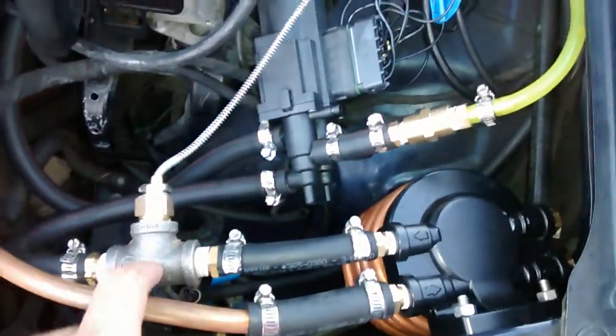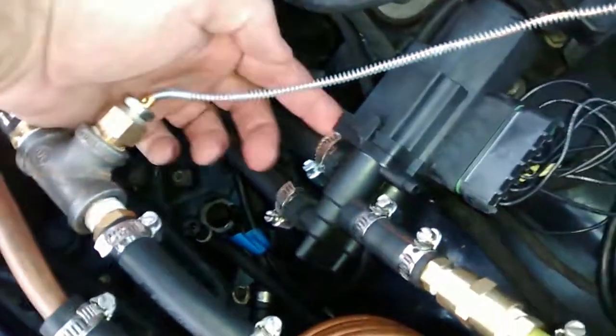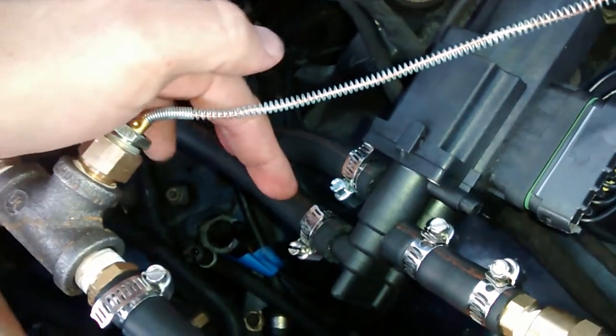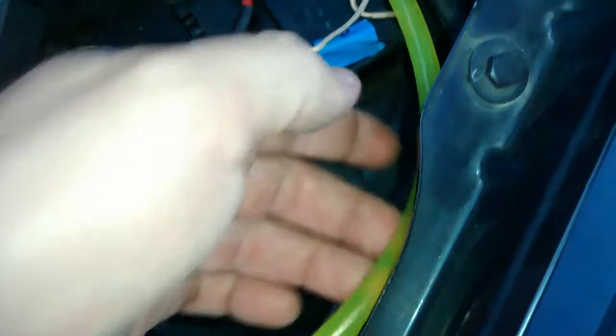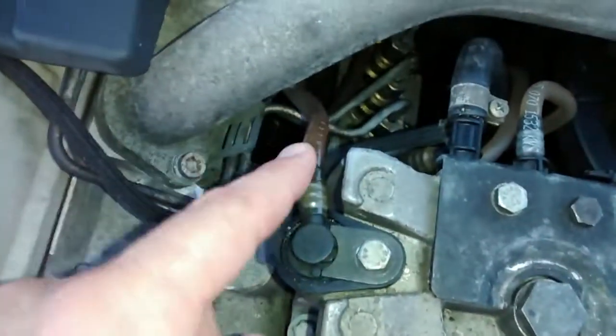So it comes in through here, goes in here and filters out. This is the temp gauge — and you'll see it's nice and cool now, the car has been off for a while. It routes around here to the solenoid switch. You have the diesel tank on this side and the waste vegetable oil on this side. It comes in through here and goes to a clear tube so I can identify any bubbles in the line when I have to purge it. And then there's the original intake coming in through here.